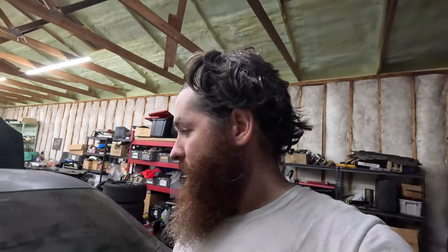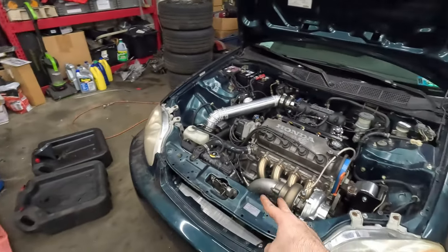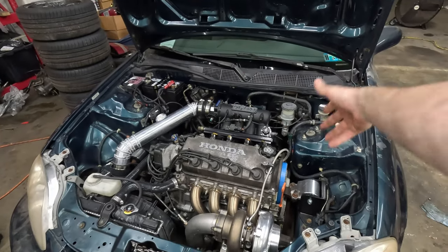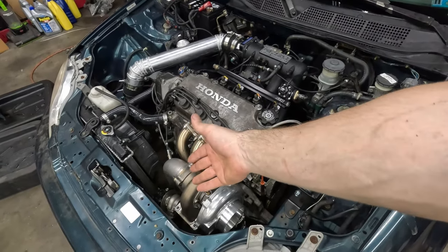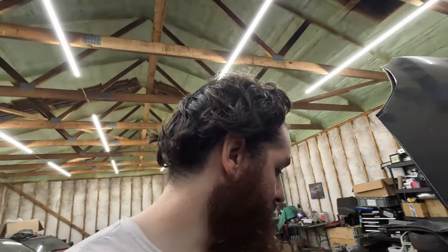We've got 100 miles to go before our next oil change. So yeah, first drive, first startup, that's finished. Not very much cool stuff going on, but this car is coming to completion. The only two things that we need to finish are a catch can system, which right now I have the lines routed to the ground, and routing the boost controller. Once we have the boost controller run, we can actually turn up the gate and make the goal of 300 that we want.